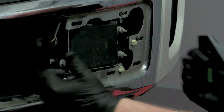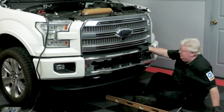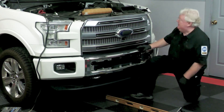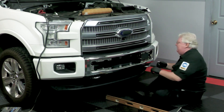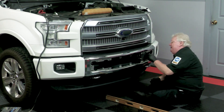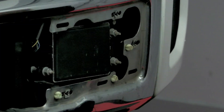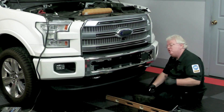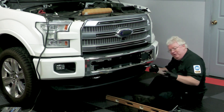The horizontal adjustment — left to right — is done on the road with the scan tool when you're driving the vehicle. So let's grab an 11 millimeter wrench, that's what it takes, and we're going to do a little tweaking on this vehicle. Now, to see if the vehicle itself is level — stock tires, stock suspension — that can be very important to making sure all these things work right.